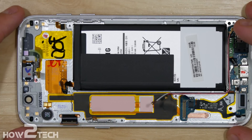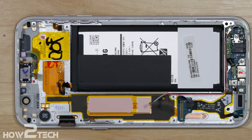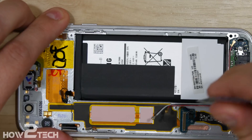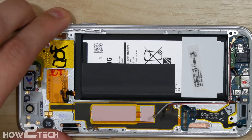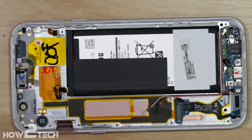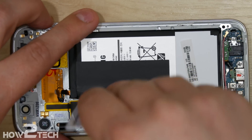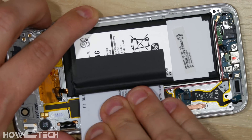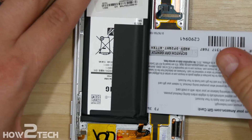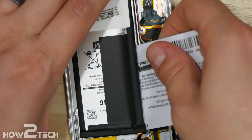The next step is to take out the battery. To do that we're going to use a flat tool. A lot of people will say metal is bad, but just don't puncture your battery and you'll be just fine. Using the dull side of the iSesamo tool, we're just going to use this to get started, to give us a little bit of an opening underneath the battery — it's adhered all the way around in a square. We're going to use a trusty Amazon gift card here — it makes a great battery remover. Just putting it in, sliding it underneath, and pushing it as far as you can. Be careful as there's an opening in the back portion of the phone where the display is, so you don't want to pry against that. Just push against it, cutting through the adhesive.